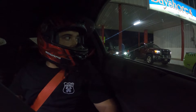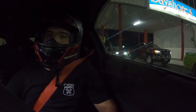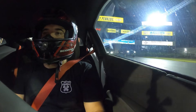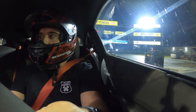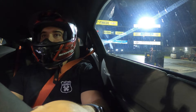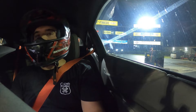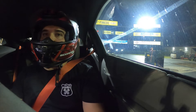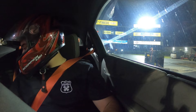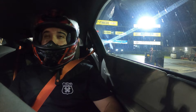We're going to be going up against a lime green Hellcat — that'll be fun. I'm sure that Hellcat is probably going to beat us; it was running pretty good times. Our intake temps are about 97 and manifold temps 130, so this is as good as it's going to get. But something always happens where it delays everything and we have to wait — our intake temps are now getting close to 138. Our IAT2s look like they're at 100 though, which is good; they were at 140 at the beginning of the last run.